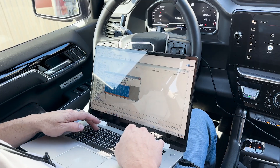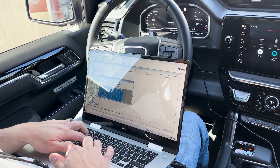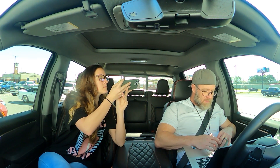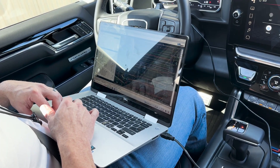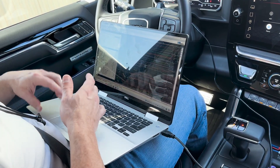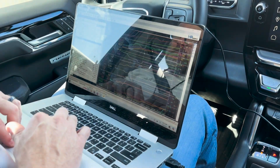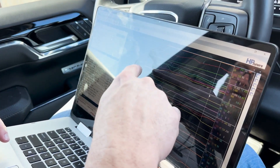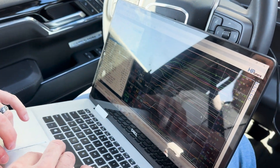Now to make some little small changes. I'm going to bump up some of the driver demand settings a little bit and see if that helps our pedal response. It also could be some limitation from the transmission side of things — the predicted torque source is transmission. To get all this as clean as I'd really like, I'd like to be able to tune the trans. Our VE airflow and MAF airflow are separate, so I'm going to try to get that lined up and make sure our fuel stays in line.